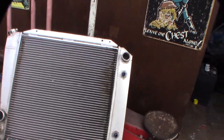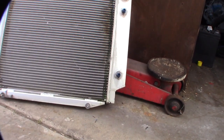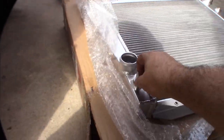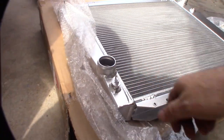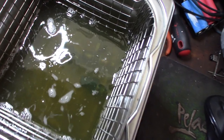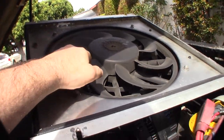Now you can probably see the leaks — I was leaking from up here on both sides. I've got to take my AN adapters, my transmission cooler adapters off. You shouldn't use the plastic one that comes with it, because these things always fail. I'm going to take off that brass or copper one right there. This part's from the ultrasound cleaner.